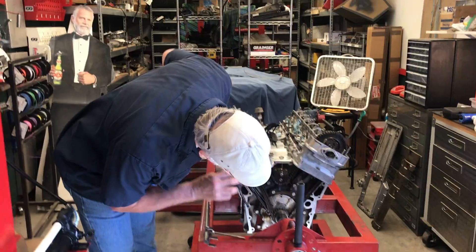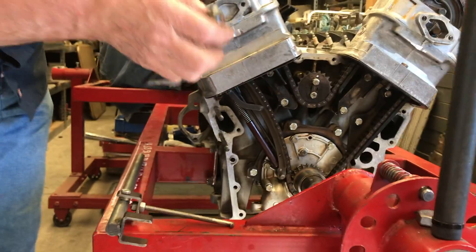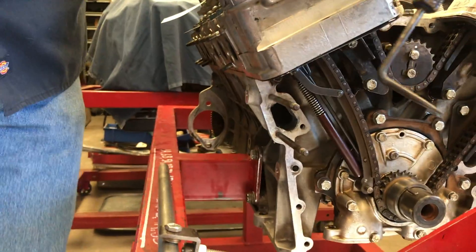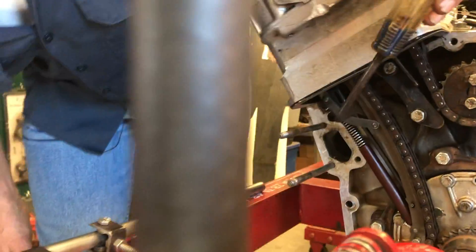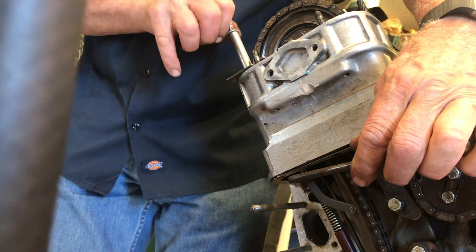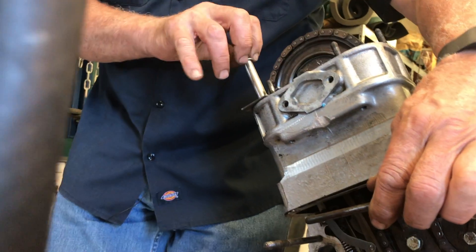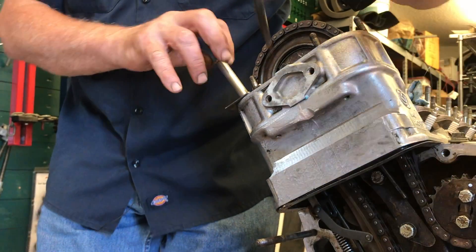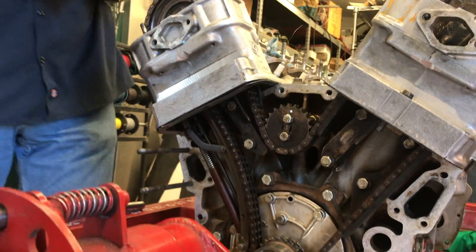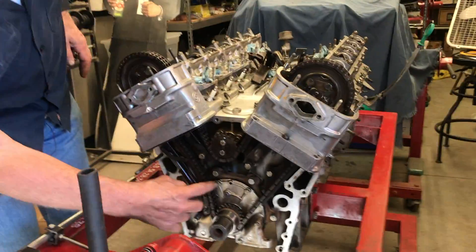What we can do now is reach in with our tool — there's a hole in the front cover with a plastic plug in it to access this. We reach in and insert our tool, which is nothing more than a screwdriver with a 90-degree bend in it — a reasonable facsimile of the Jaguar tool — and we rotate this clockwise, then slowly remove the tension on the tensioner. And there you go — you can see now that the chain is tensioned all the way around.